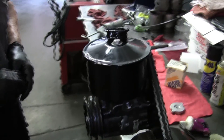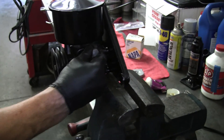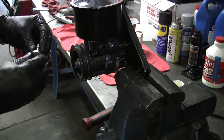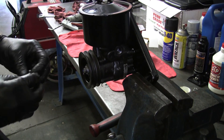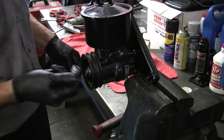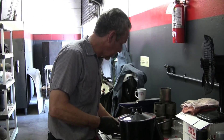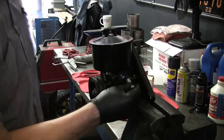When this goes back on the car, the high pressure hose goes here. There's a banjo fitting that goes on here and there are two o-rings — make sure you replace those. We found a leak on this car at the steering box just recently where one of the banjo fittings was missing an o-ring and had been for years. That's why it leaked. So you want to put new o-rings, and then it's ready to rock. Install it and tighten up your belt.